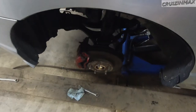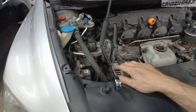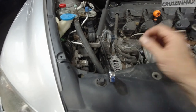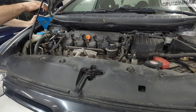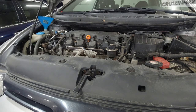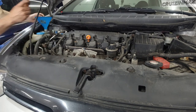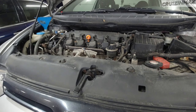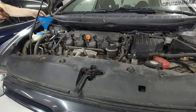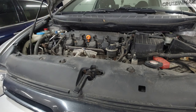I'm going to fill it up with power steering fluid — and I forgot about the belt, so I'll do that first. Fill it up with the engine off; you don't want to run the pump dry for too long. It's all the way up right now. Go inside and turn the steering wheel left and right all the way, both sides, several times. It went empty. Repeat the process — it's actually full now. I'm going to cap it at this point because it sometimes likes to shoot out the fluid. Then start it.